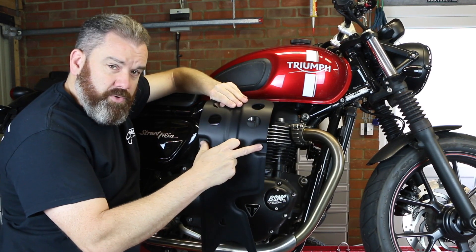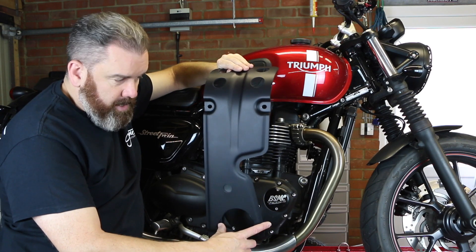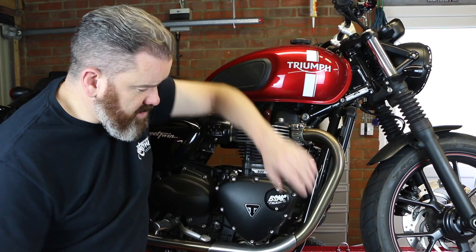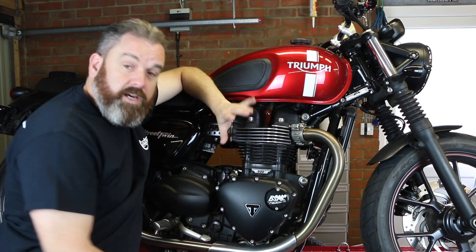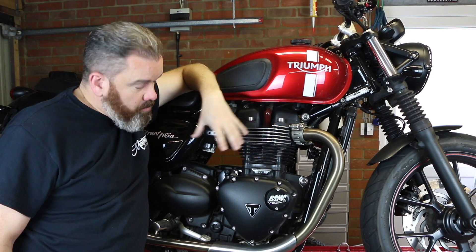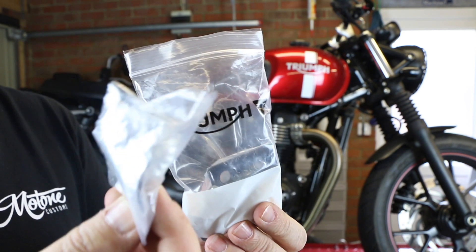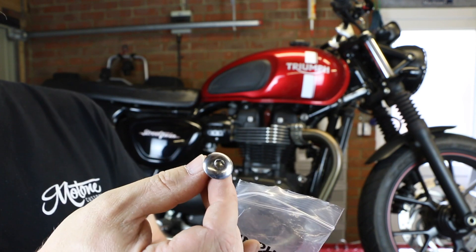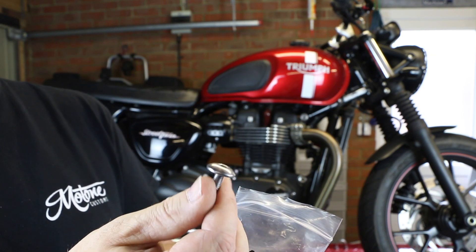There are already tabs on the frame to take these, they just need a little clip fixing to them, and then there's two brackets that go on the mounts at the back. It adds that little bit of protection underneath the bike but it also covers up that section at the front where the catalytic converter is, or in my case the x-pipe, just makes it look a little bit neater. You lose a little bit of ground clearance but you gain some protection. Now I've got the bike up on the stand just to make it easy to film — this can obviously be fitted whilst the bike is on the side stand. As ever you get a comprehensive fitting kit from Triumph: a couple of brackets that fit to the back of the frame and then the bolts to mount the bash plate underneath. The bolts come in silver and would be great if they were black on black accessories, but I understand the restrictions of costs and logistics on having two different fitting kits.